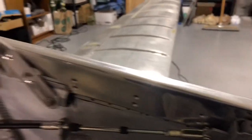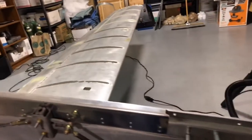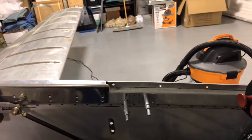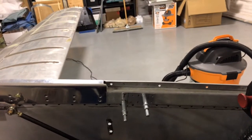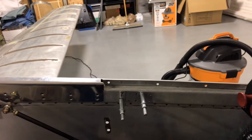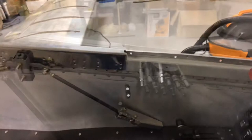I've fitted the left-hand side latch. I've got the pin in for the push-pull cable and the rod attached for the handle itself. I've taken it over center and pulled it all the way to the latched position, then marked where my forward doubler needs to go for mounting the handle. That's pre-drilled so I've got two holes to pilot it and hold it in place. Now I'm in to mark out the rest and drill them out to the larger size.